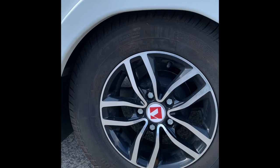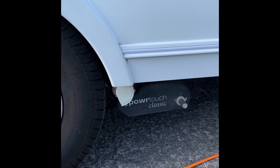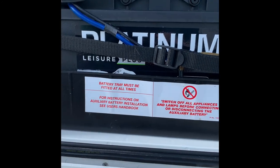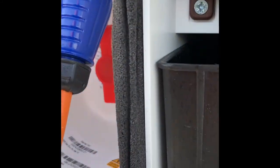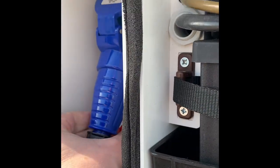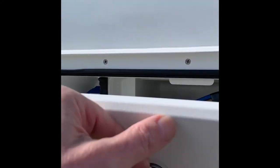This particular model has the Power Touch Classic motor mover - there's a separate video to show you how to use motor movers. This is where the isolator key for the motor mover goes in. It's placed behind there, so it's very difficult to connect the motor mover whilst the electric hookup is in, and that's a good safety feature.